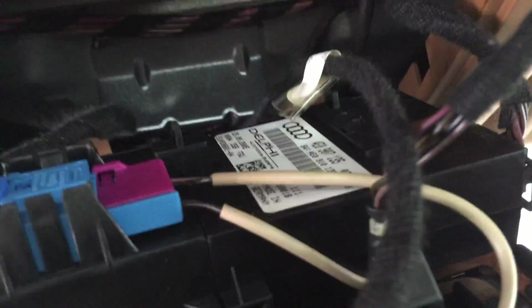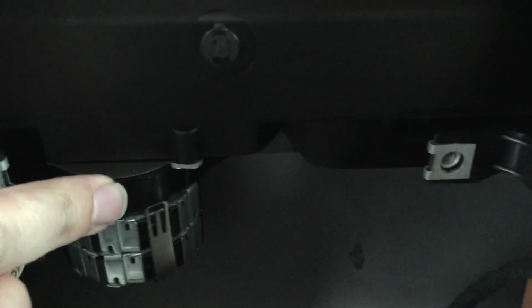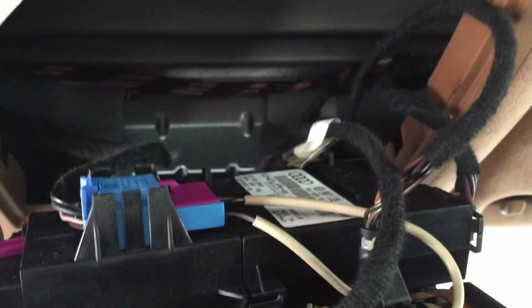So now, again, because it's only on the forums, I don't know which of these motors is actually the offending motor. It looks like we've got one up here. I'm wondering if that's it. I hope this is not completely idiotic, but I don't think I've done anything that would affect the sunroof operation. So now that it's out, I'm gonna try to operate it again to actually listen for where the grinding is coming from. So I'll start the car. All right, and I'll reach under here and I'll crank it open. Seems to be coming right from that. I don't want to touch anything. I don't know if I'm going to get shocked, but let me...